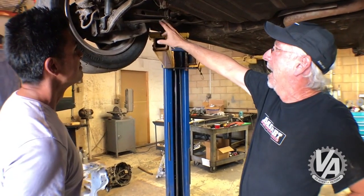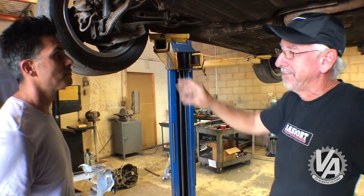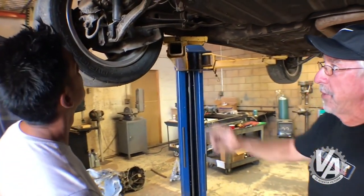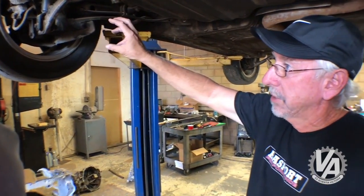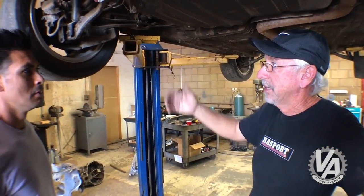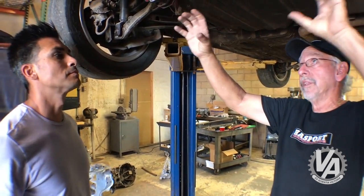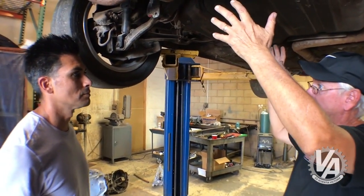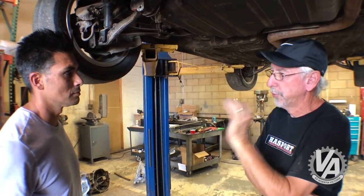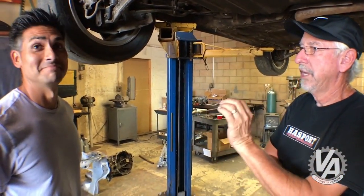It's funny — I actually would almost like to farm out the lower control arms. Originally I was thinking we could modify stock control arms, but I don't think there's any advantage to that. I think a wholly fabricated part would be a good idea. In that way you could choose your hub a little bit more easily, because there are CRV hubs and Element hubs which are made by the hundreds of thousands. That might actually be a better choice in the long run, but there may also be some other aftermarket choices as well. I'm interested in making the diff carrier and everything that bolts in this area and getting it all set up properly so the geometry stays as close to original as possible. Honestly, I want you to be able to jump this car when it's done, not just drag race it.